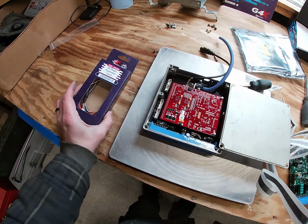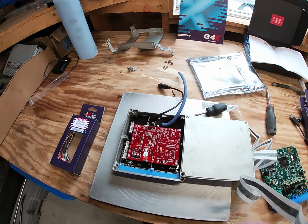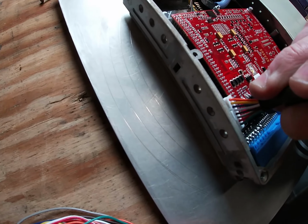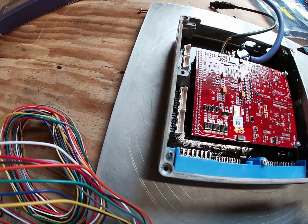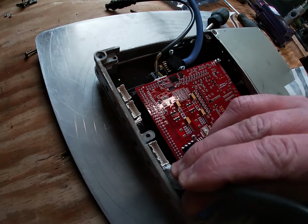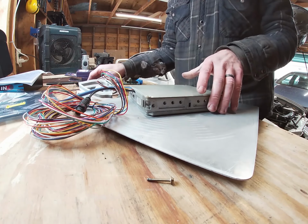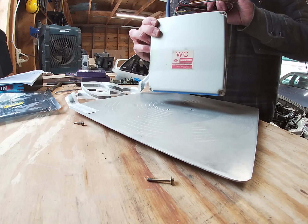Yeah, we'll get that plugged in and run out of the same place that the tuning cable and the map vacuum hose are. So here's the loom. It's a pretty long cable, and I'm pretty certain it goes into this one here where we have our temperature, voltage, digital ins and outs, as well as a ground and a 5-volt supply. There we go. That's all done. Oh, there's one more thing to do.